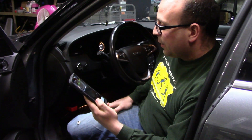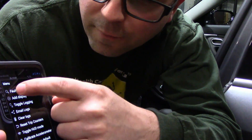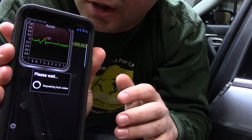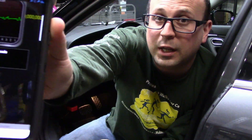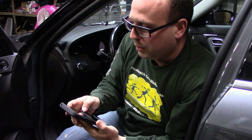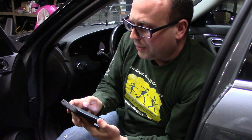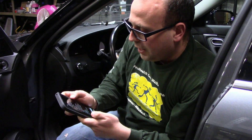Turn the car on. It's connecting. Click the little gear in the corner, hit fault codes, show logged faults — and it's doing things. I have P0234. I'll select that: turbocharger over boost condition, which goes exactly in line with the boost control solenoid being bad. I can actually hit web on this — it links to DTCsearch.com, which is actually really nice and comes up pretty well.